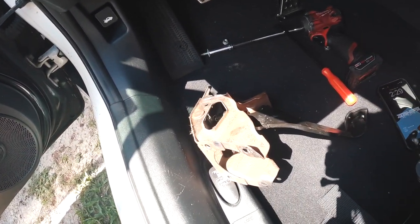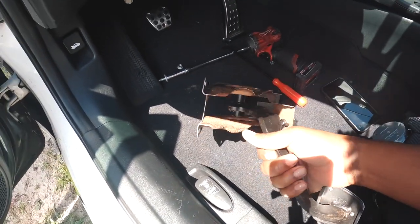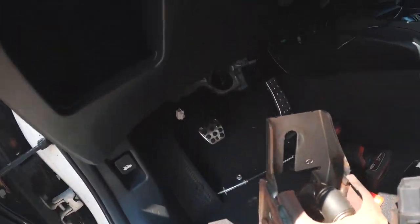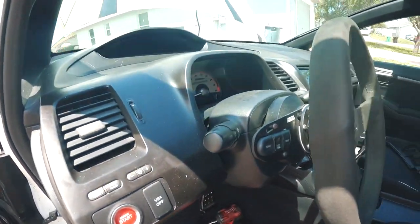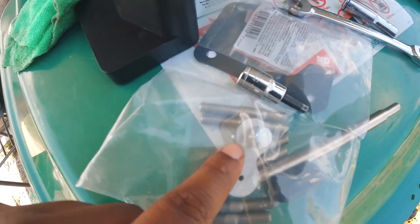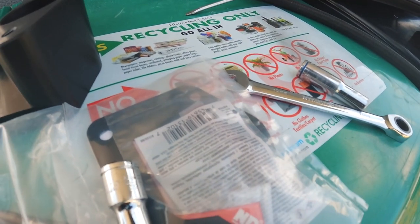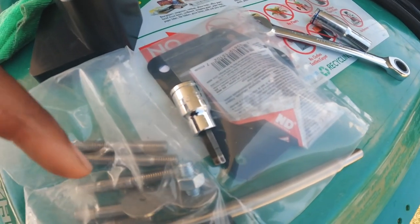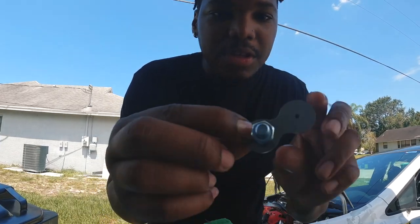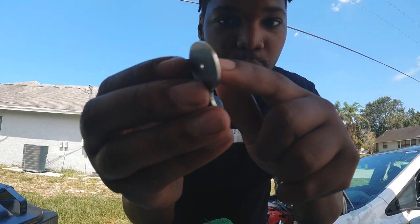Going back inside the car, we have to remove the brake pedal. We have to drill a hole exactly one inch above the existing hole — that's for the six-to-one pedal ratio. To remove the pedal it's those four nuts, and one up top, and that's it. They provide you with a template right here, so you don't have to do any measuring — you just literally bolt this up there, bolt into your old one, and drill a hole for that. Simple.